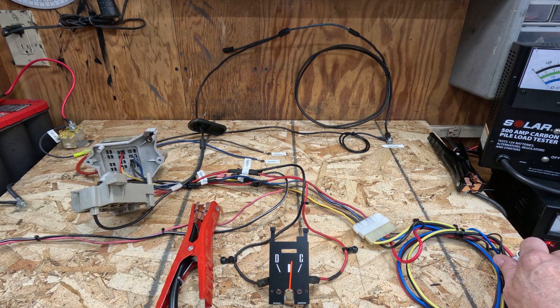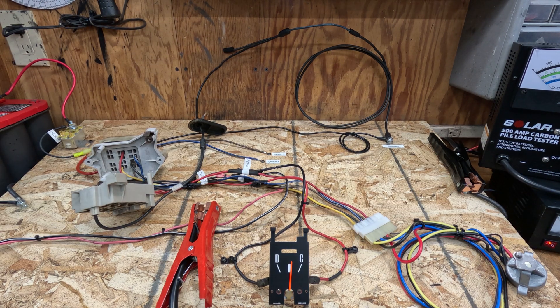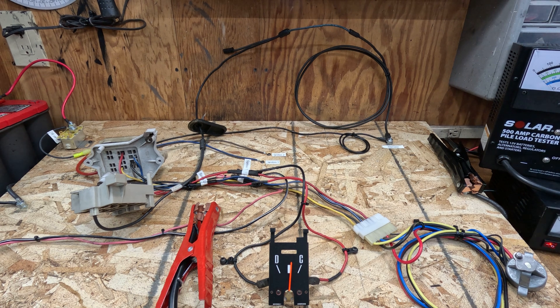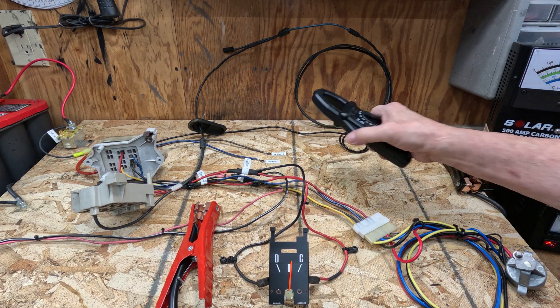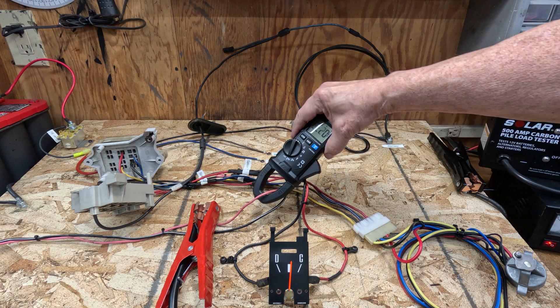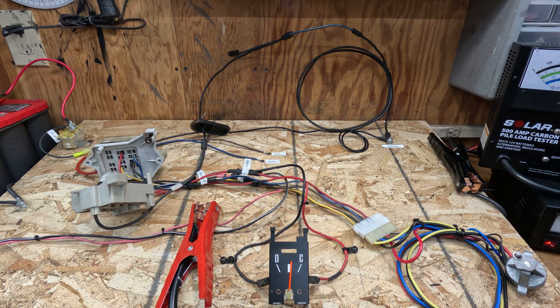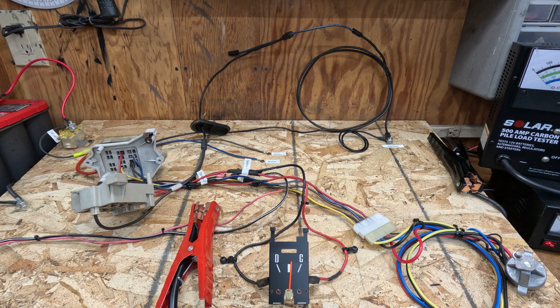Spade in — let's turn our loads back on and see what we got. Dialing in a little bit more so I can see some comparison — we're back to about 20 to 25 amps. Let's verify the total current — dialing about 20 amps. That's 20 amps on the load, 24 amps total. About 18 amps for our load currently; the battery is pulling about 4 amps, so 22 amps maybe.